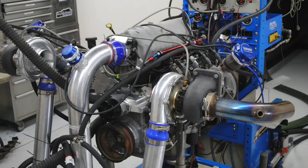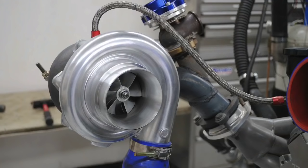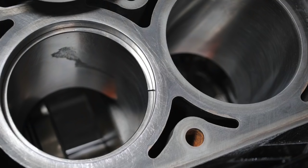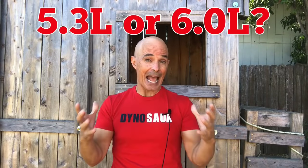Stock bone-stock motor, 1,300 horsepower on a 5.3 liter — and there's still power left. I have to admit, twin turbo junkyard LS Big Bang motors are some of my favorite testing. Here are some things I'd like to change if I revisit a 5.3 liter Big Bang test: first, better turbos than the CX Racing 76mm units; second, upgrade to ice water intercooling; and third, rev the motor — I only ran it to 6,200 or 6,300 RPM, there's a lot of RPM and power left. Can a 5.3 liter, because of its cylinder bore size and head gasket sealing, actually make more absolute power than a 6.0 liter? Let me know in the comments.